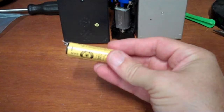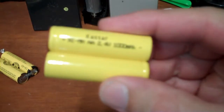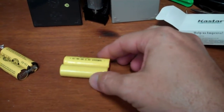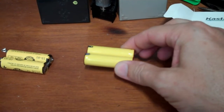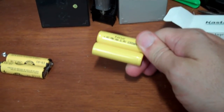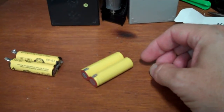So the batteries I'm replacing are NiCad. These guys were advertised as NiCad battery type online, but they're NiMH, which has a similar voltage, but the charging profile is different. But since these guys don't accept returns, I'm just going to solder it into my shaver, leave them a 1-star review, and call it good. I won't be leaving the shaver plugged in after they're charged, so it'll be mostly safe.